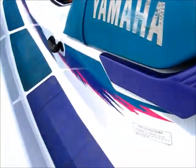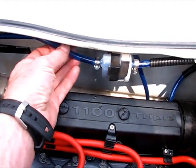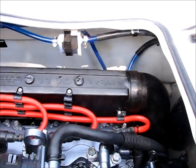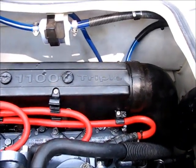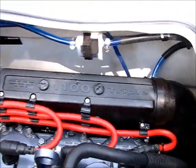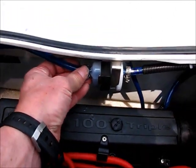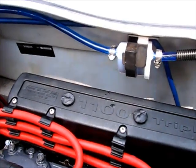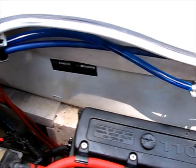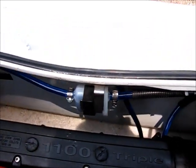The rest of the fuel line is this blue stuff here — it's quarter-inch line. I don't recommend doing it that way. I used 5.5 millimeter, which is 7/32, fuel line everywhere else, and it went back together real nice and tight. Quarter-inch fuel line — you've got to almost use hose clamps to make sure it's going to stay put. I left it there because it's all exposed and I can see what's happening. The beauty of the clear line is you can see gas moving, so if you're having trouble starting your machine you can see if it's moving through the filter.